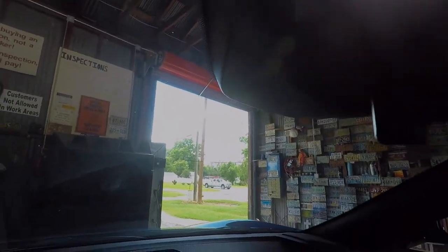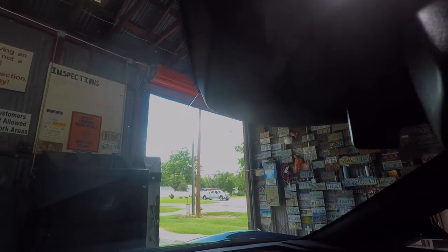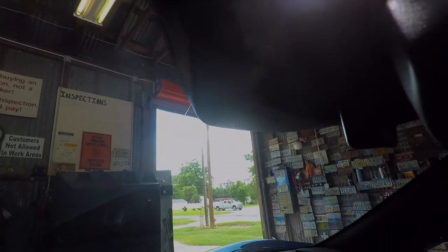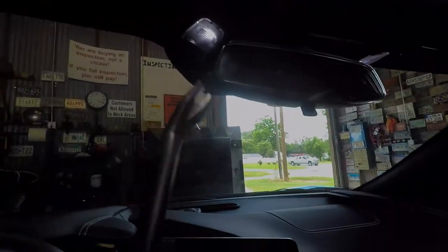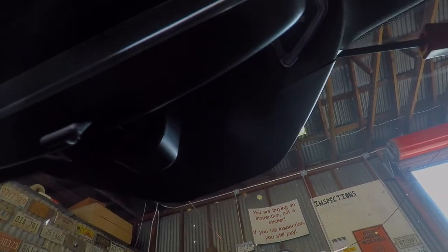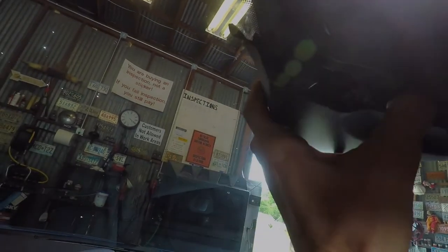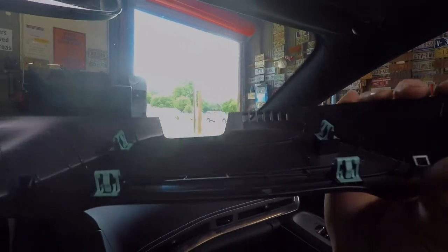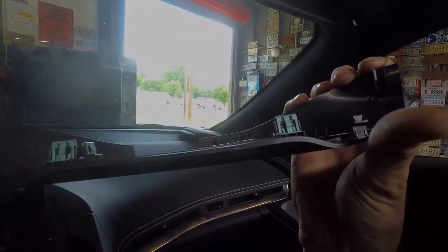As far as the little cover for the lane departure, they're all kind of generic most of the time. I don't know how this one comes off, so I'll start at the top corner and just pull a little bit. Like a Toyota Camry — on the bottom of these covers they have little slides, so you go up then snap the top. The top is the best spot to start. It's just four clips, that's all you're trying to get.